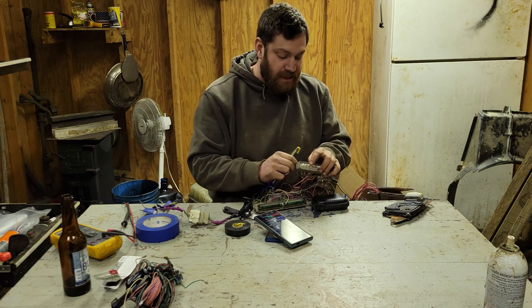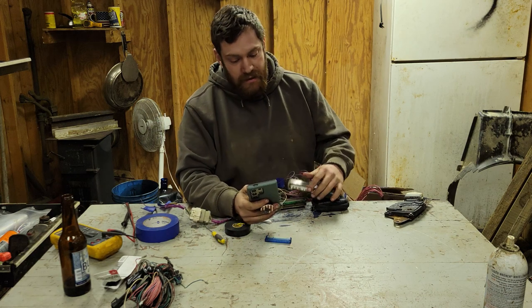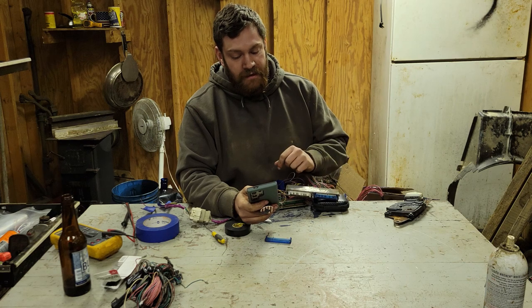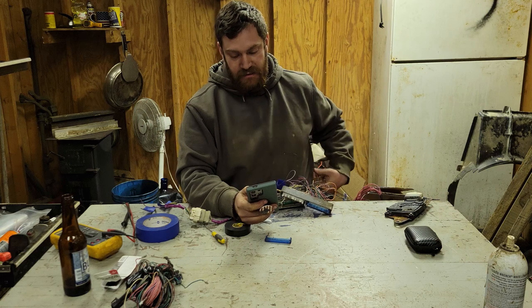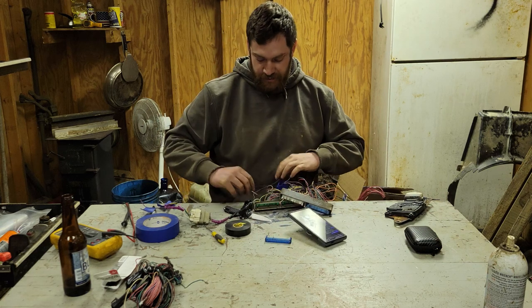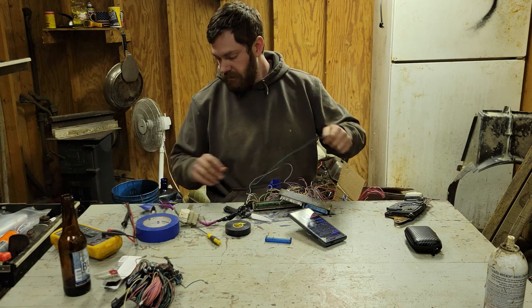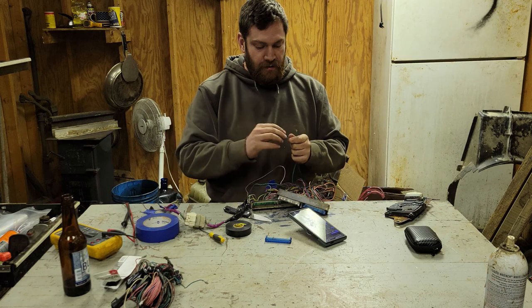See, I was just testing you, and you passed. Congratulations. Then pin 42, it's empty, but you can use it for electric fans. Serial data, which is your data wire for your OBD2. Just double check. I'm pretty sure I made that one green still.